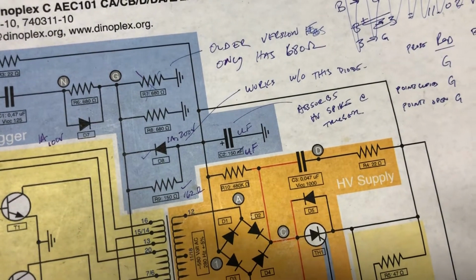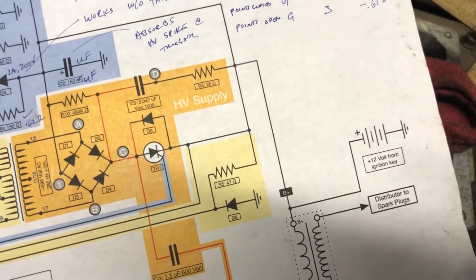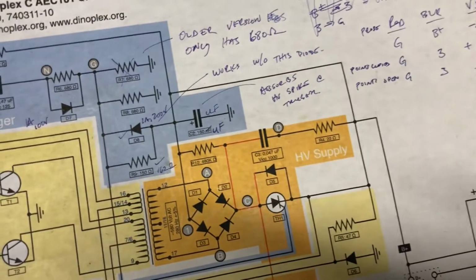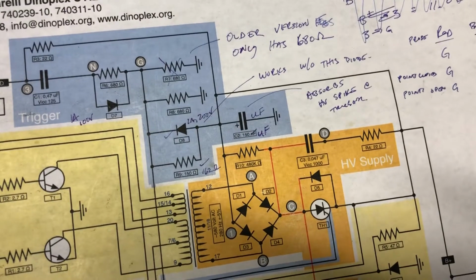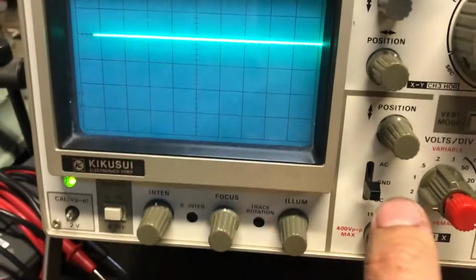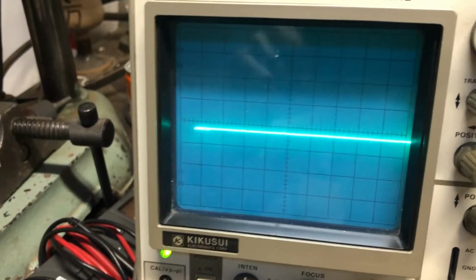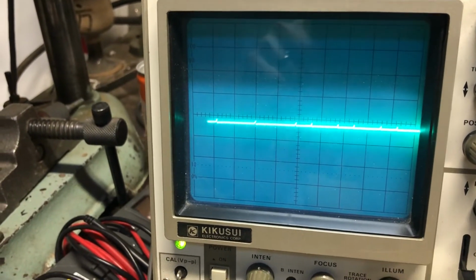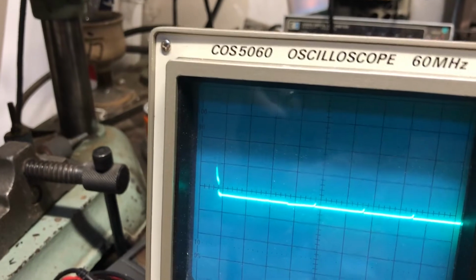Alright, for a sanity check here is G to 1, which is the battery voltage reference, and the reference that's across the thyristor. G is the probe and 1 is the reference. And so you'll see I'm on ground. This is 0. So the voltage at steady state is slightly lower, which would keep the thyristor closed. And then you can see these spikes come through. If I run that, you can see the spikes.